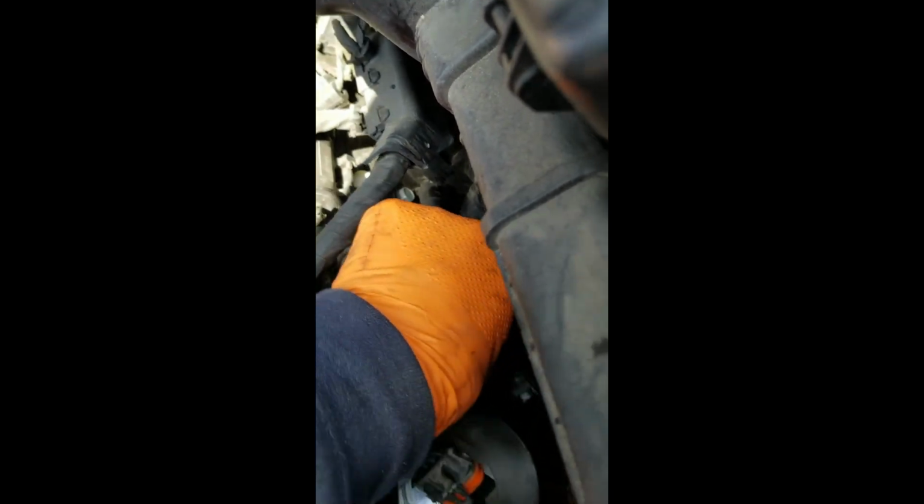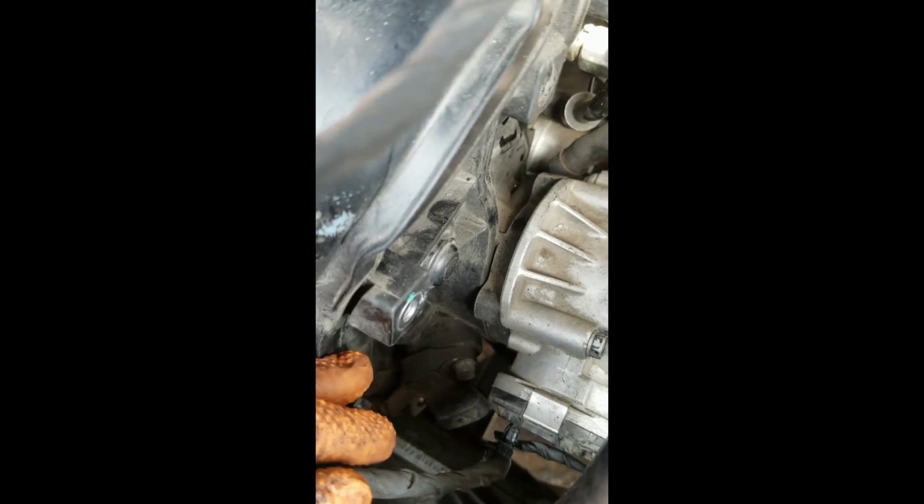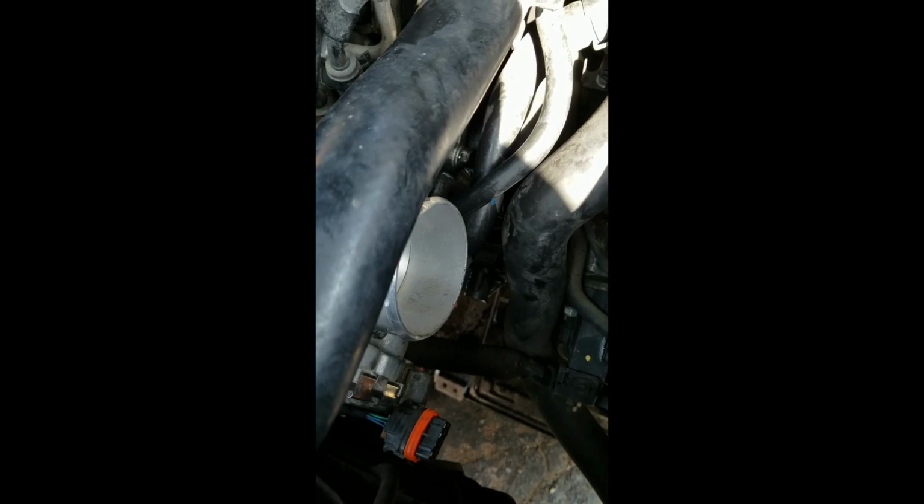and wind it around the cooling hose, which is right here, and wind that puppy around there. There we go. And kind of a tight fit, and it comes. Okay, so now you got plenty of line. Okay, so this is supposed to actually come around the front of the throttle body. So there's a bracket here with a 10mm bolt. Okay, so now we got plenty of line for the sensor that goes into the intake manifold, and also the one that goes on to the throttle body. Okay, common mistake and easy to fix.